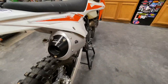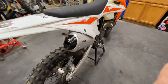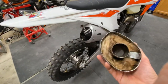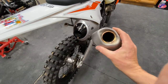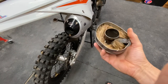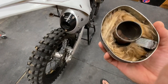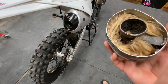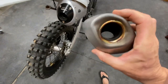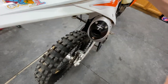We haven't done anything to the fueling on this bike other than an end cap, and that didn't change the fueling. These motocross bikes come with mapping sufficient to run a full-flow exhaust, so I've got the stock exhaust — this is what came off the bike, a 40mm outlet. The only problem with the stock is it does not have a spark arrestor. It's got this little bug screen, but that is not a Forest Service-approved spark arrestor. So if you're going to ride somewhere where that's an issue, you'll need to swap it out. We went with the Pro Moto Billet end cap that has the spark arrestor.